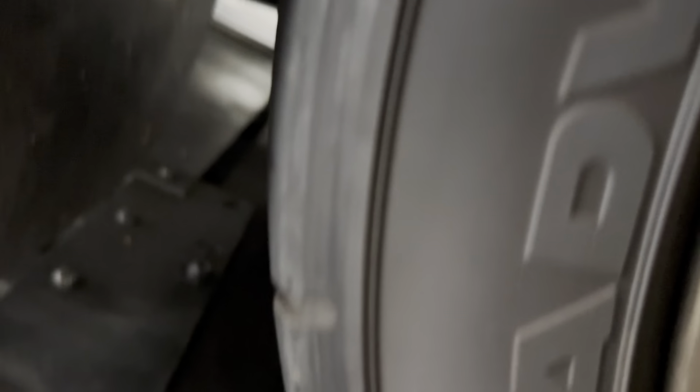I'm pretty sure there's a nail in my tire — oh there it is, holy shit, look at that sucker. So going off that last little run: he had wastegate pressure down to zero which held the turbo at about seven pounds, and then around 4,400–4,500 rpm he started seeing it spike up to 13 psi, and that carried all the way to redline. For seven pounds spiking up to 13 — that's pretty impressive. I think we're gonna be pretty good today.